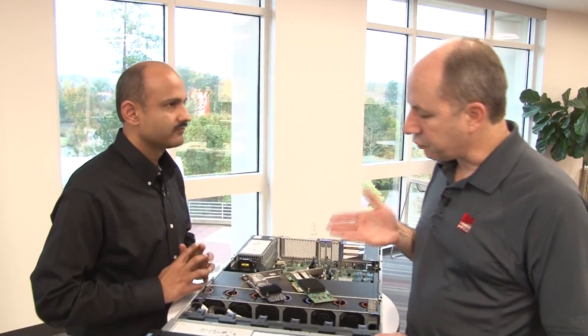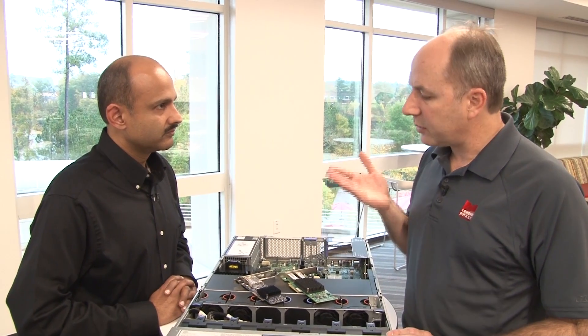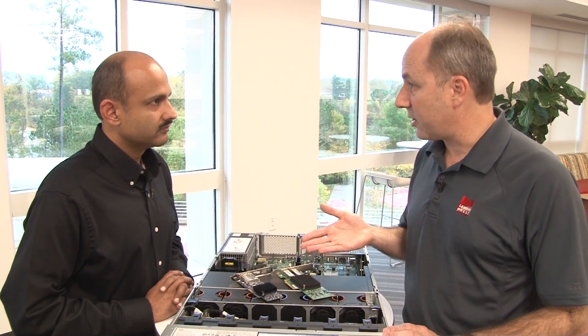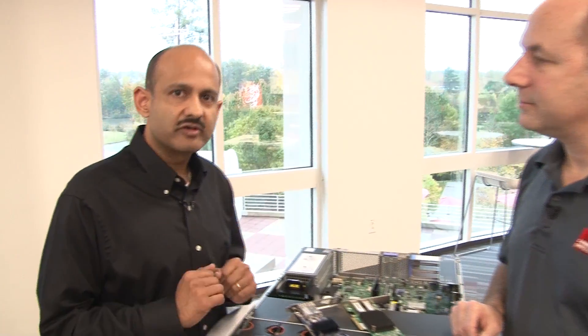These are the VFA 5.2, the second generation VFA 5.2. So what are the key differences with the second generation VFA 5 versus the current ones? The first key difference is the XClarity support — or improved XClarity support — with these adapters. In this version, we can not only support inventory management to scan what is on the system, but also do firmware updates.